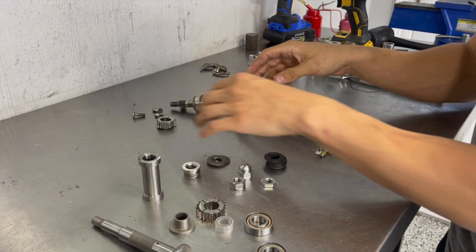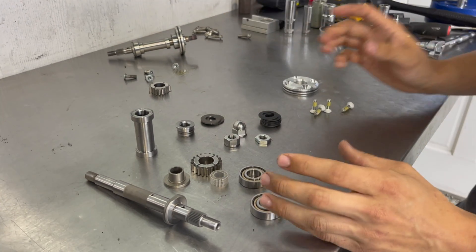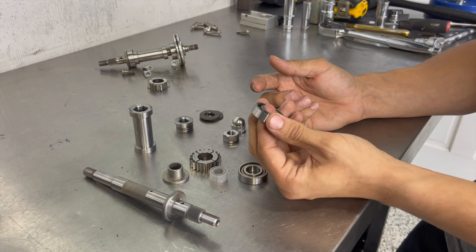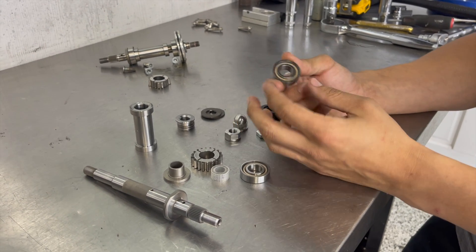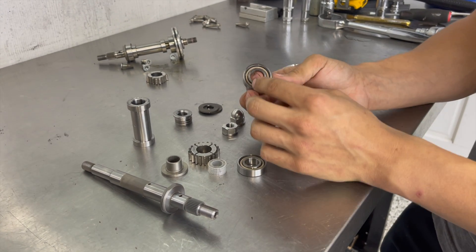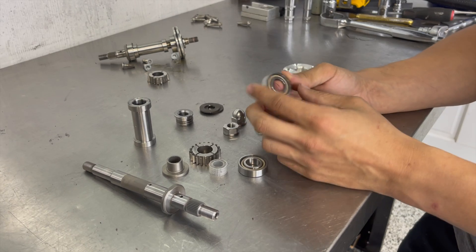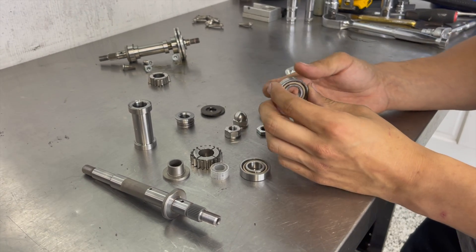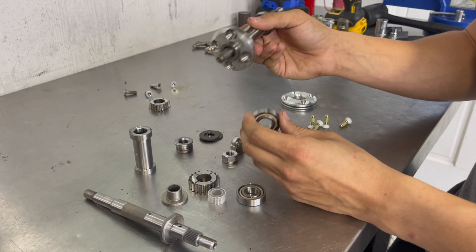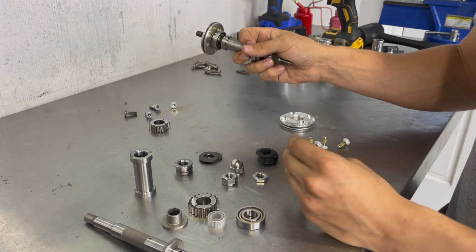So we need to get this thing rebuilt. Taking a look at some of these parts we can see why some of these things do fail. One of the failures we have are bearing failures. The 300s use a much better bearing than the older style and I have not had many bearing failures with the 300, but they have happened. Over time these bearing cages get a little brittle and they break, and that causes the bearing to fail. When the bearing fails the shaft is no longer held straight — it wobbles around and wipes out the supercharger impeller against the housing. Obviously not good.